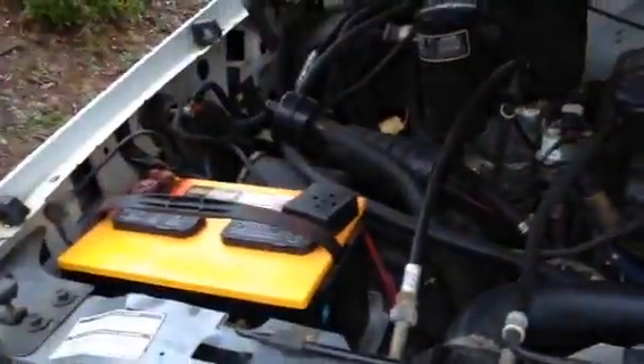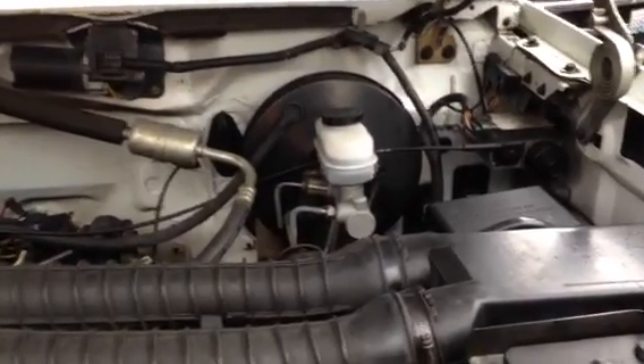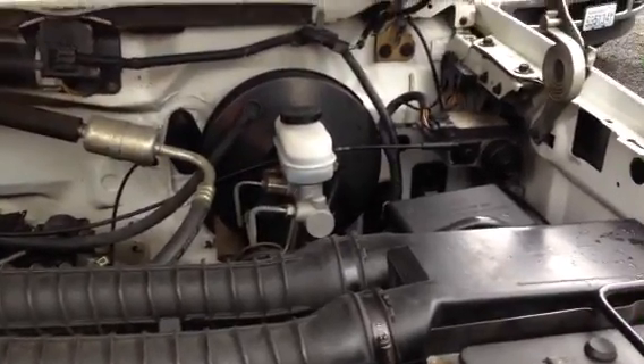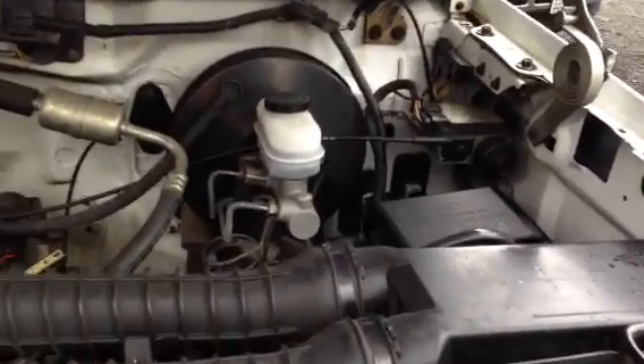Before you do that, take your battery cables off. Anyway, this thing had been having trouble — they'd replaced a fuel pump, which I told them it didn't need, and a throttle position sensor, and it was still having intermittent problems. So it was a bad computer; they pulled the code up on it.